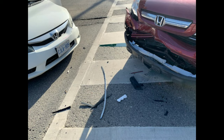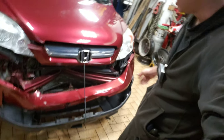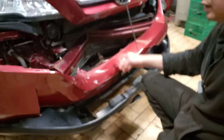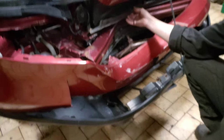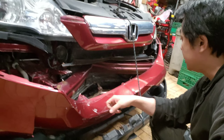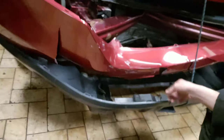What we got here is a 2007 Honda CRV and clearly it's been in an accident. Surprisingly, airbags didn't go off — I guess it just missed the sensor. The headlight is wobbly, so the headlight bracket is broken. The grill, this filler piece, and the other filler piece are damaged. The rebar, rad, rad fan, AC condenser — this little rad support is pretty banged up. This is going to need a fair bit of work.